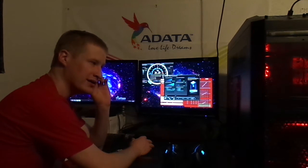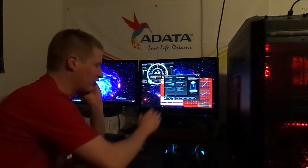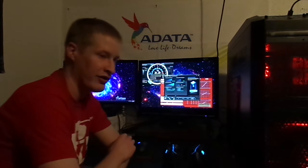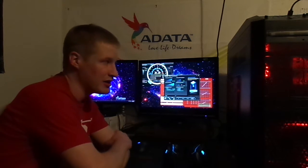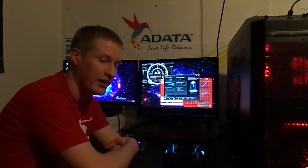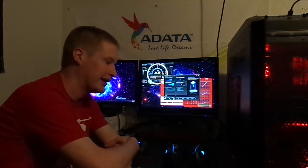I don't know why that is, but usually I've only used these final level of load line calibration to get up to the 4.85 gigahertz range on an FX-8320. On this 8320, it's probably never going to see more than like 4.4 or 4.5 because the performance boost is just negligible.